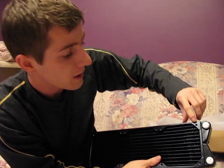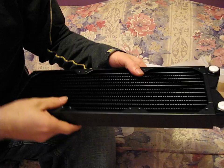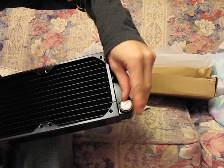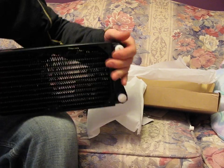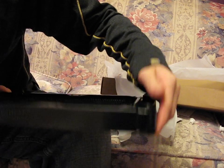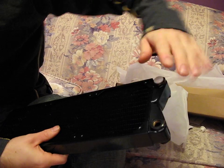You can see we've got our threaded mounting points — 12 total, six a side. And then we have the same thing on the other side of the rad. What you may have noticed when I flipped it over is that there are actually mounting spots for the barbs on both sides of the stackable radiator. That's what I was talking about before — you can use either two stackables, or one stackable and one non-stackable, to set up two radiators next to each other with just fittings in between. A normal radiator would only have fittings on one side.